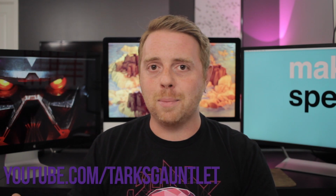But also a huge thanks to my buddy Shawn and to Tarks Gauntlet for pointing out that not only does the splitter make this possible, but also for specifying that version 1.3 is exactly the one you want to use, because I think if you go anywhere north of that, you won't have the same results. But having tested this myself, I can say definitively, this OREI HDMI Splitter X2, which I think is like $15-20 on Amazon, absolutely did the job, and it's been working great so far, not just for the PlayStation TV, but also for my PlayStation 3.